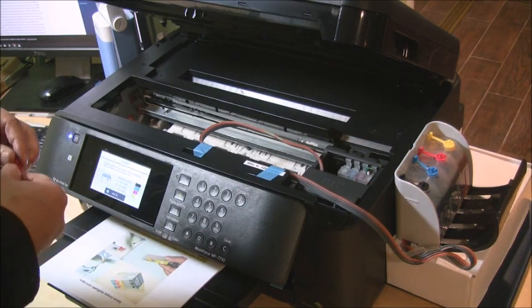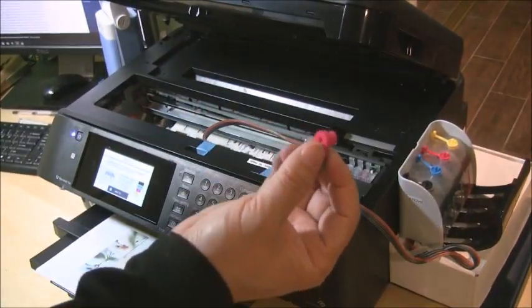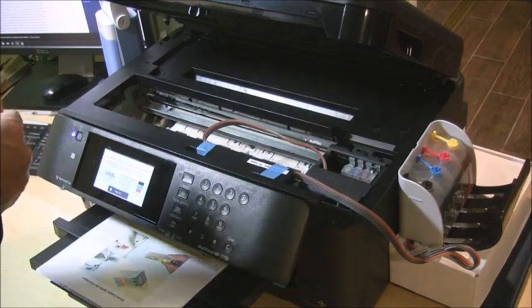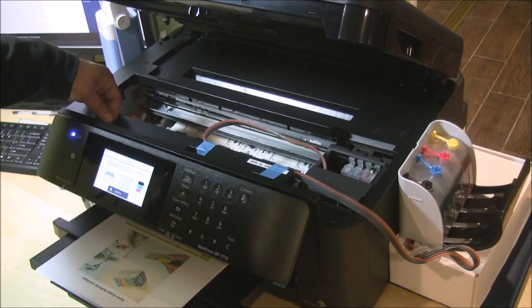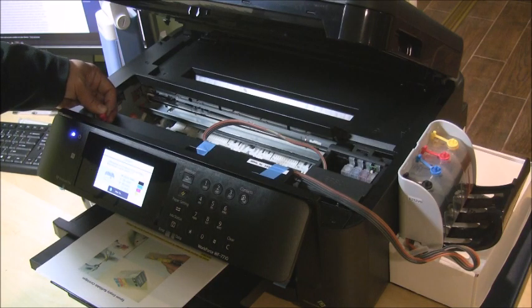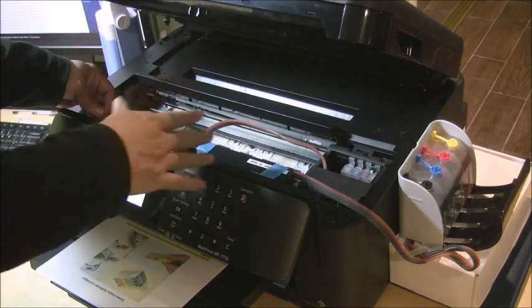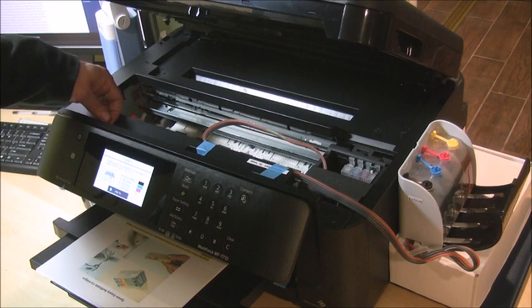The system comes with a rubber plus jumper. The purpose of the jumper is to tie the printer and the scanner unit together — we put it here, which keeps the scanner unit from being fully closed. Right now, because we are doing testing, we don't want to close the scanner unit — we want to watch how the cartridge is moving to make sure we don't need another adjustment with the tubing.